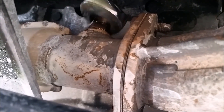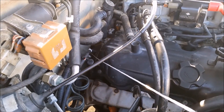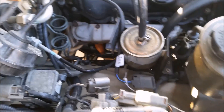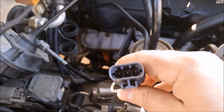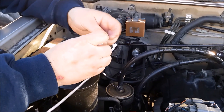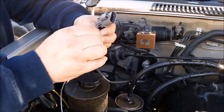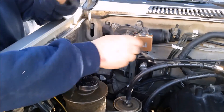We've got the old sensor out and the new one installed. Now we need to get the connector back up — remember we tied it to the string. Look how easy that is, just pull it right up. You can imagine how hard it would be to crawl into the vehicle and deal with that otherwise. Here's the new connector. I decided to show you the string trick: just tie a slip knot, make a little loop, run the string through it, wrap it around the sensor wire, and pull it through.